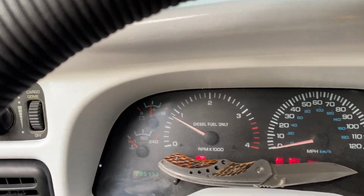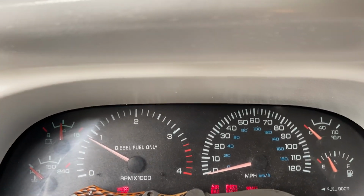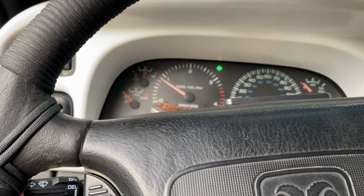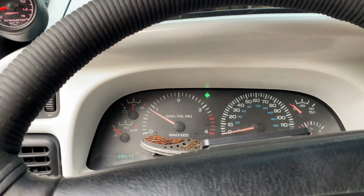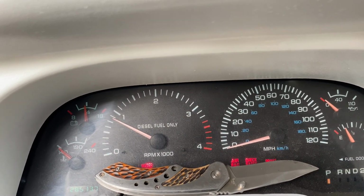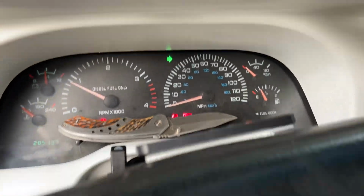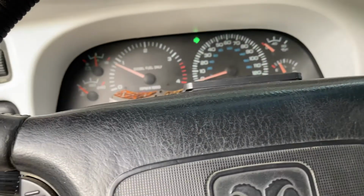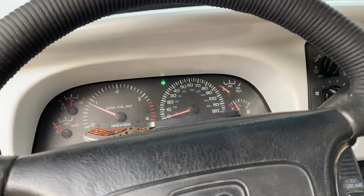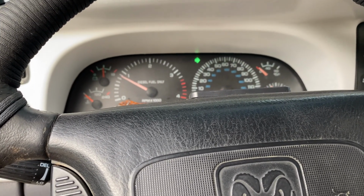New switch is in. Our running lights are on, the mode it was giving us the trouble in. Left blinker, good as usual. When you move it up and down, that extra little play doesn't affect it at all. Go to the passenger blinker, or right side. It didn't hesitate or jump or anything when I did that. You can very clearly, oh, let me turn the wheel. There we go. Oh, focus. The extra little bit of movement that you play with it doesn't affect it at all.